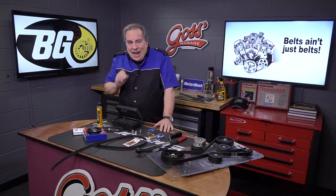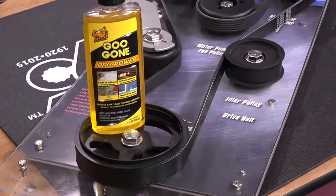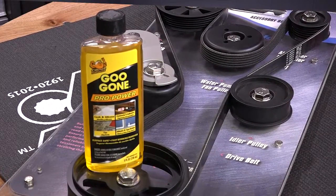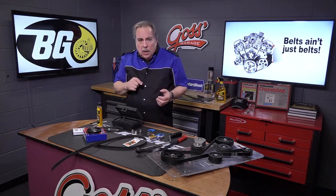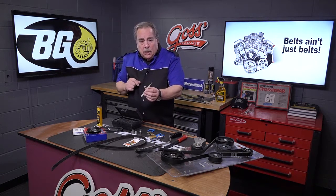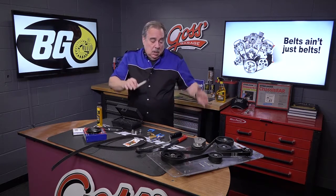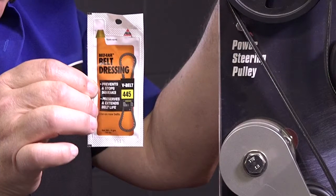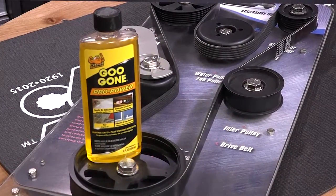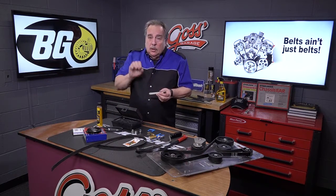So if you've already made that mistake, what you need is a solvent. That solvent has to be applied to each one of the pulleys and to the belt — all the way around each pulley. Take an old toothbrush and scrub down into the grooves of each one of the pulleys. This could take a couple of hours to clean up, but it's the only way to get rid of the noise. The rule is simple: don't put belt dressing on a serpentine belt, and if it happens, use the proper solvent to clean all the residue off every pulley — otherwise, even with a new belt, you'll still have noise.